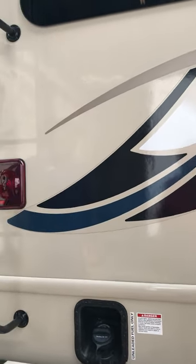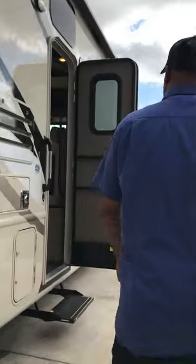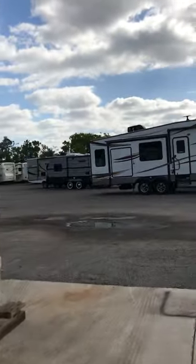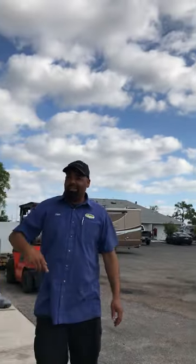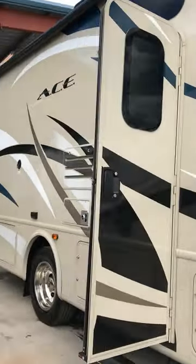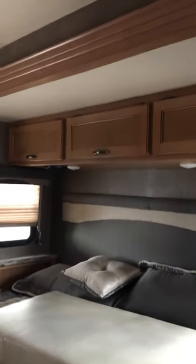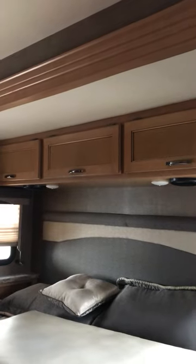Okay. Alright, I'm gonna throw the slides in, that way we can look at that side without having to crawl. Go in and watch. Well, it's just a matter of hitting the switch. Yep, I'll let you do it so you have the experience. I'm doing it. Now, what are you looking for over there? I always walk around to see if I'm clear coming in and out. Okay. So you always want to walk around the coach before you put the slides in, or out. Yeah, either way. And then you always want to look to make sure there's nothing in the coach, like in front of the bed, even though your bed doesn't really come in that way, but in front of the slide also. If you have a chair laying on the ground right here? Yeah, it'll kind of hurt the slide.